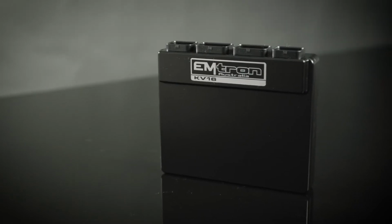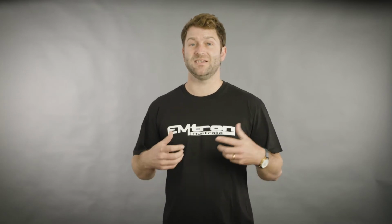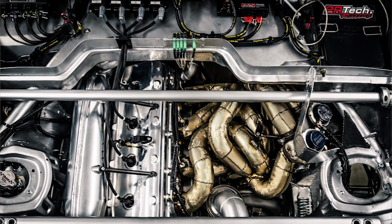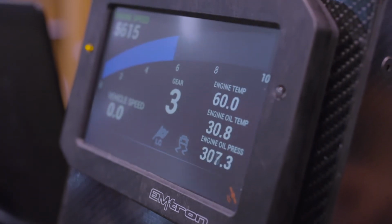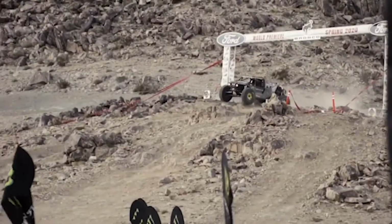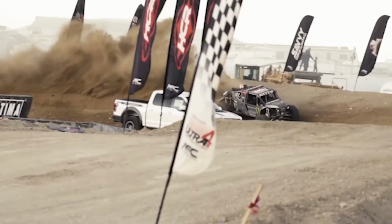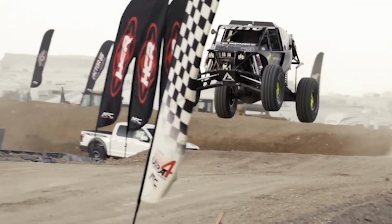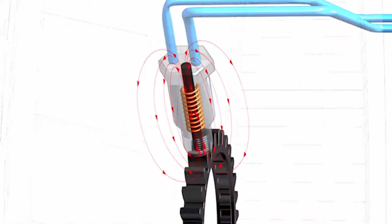Analog input channels 1 to 16 are sampled using high resolution 12-bit analog to digital converters with a 0 to 5 volt input range. All channels support ratiometric and 3-wire absolute base sensors such as map, throttle position, and pressures. Channels 7 to 12 also support the thermistor 2-wire sensors such as engine temperature, inlet air temperature, and switchable 1000 ohm pull-up resistor control.